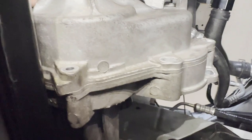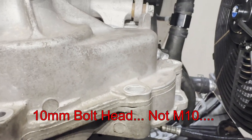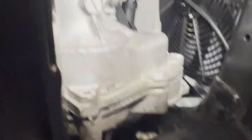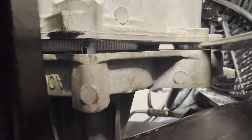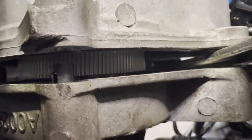We're going to take out this bolt — this one is M8, the ones out here were M10 — and one right there and one right here. That should let us separate the rack and pinion in half, which would make it a lot easier to get out. We wiggled it some and got it open — you can see the gears in there. Thankfully there's no oil, so we're not getting drenched. There's a belt that runs between the spline and the gear.